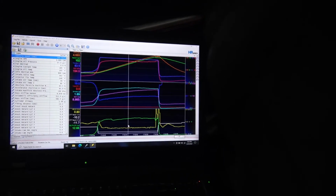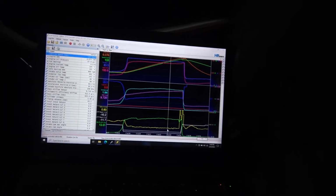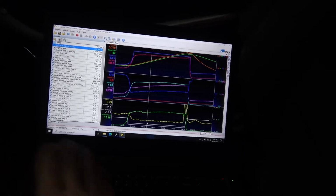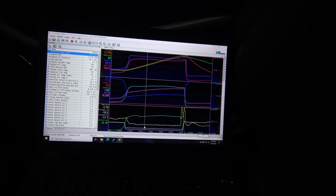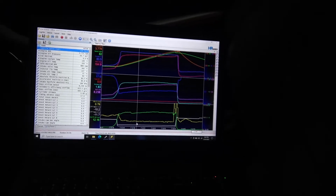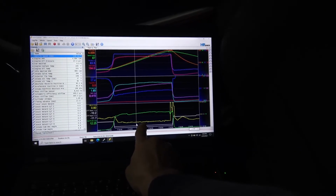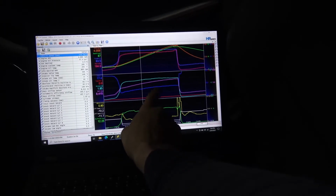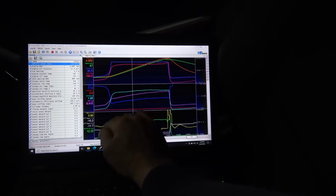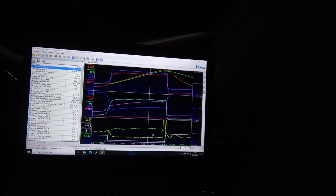So I like running these LSAs when we're leaning on them like this on pump gas, 93 octane, right at 0.8 lambda, maybe just dipping to 0.79. I know that sounds rich, but typically on the LSAs you can push them a little richer, and because they're low compression, they really like timing. They just love timing. So if you lose 3, 4, 5 horsepower going a couple tenths richer, that allows you to run another degree of timing. A degree of timing is worth like 10 or 15 horsepower, so it's always worth it to push a little richer to get that extra degree out of it.